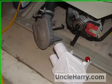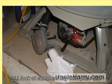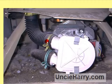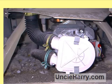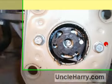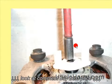With the cabinet off, the pump can easily be removed, gaining access to the motor. Pump can be replaced if it's leaking by taking this screw out in one blow, removing these clips and the motor clip. The motor can be lifted right out, gaining access to the most popular repair of all, which is the sheared motor coupling. Here's one all broken into pieces.